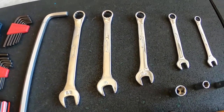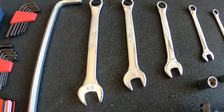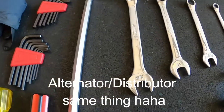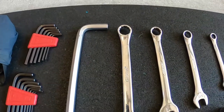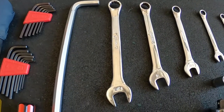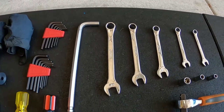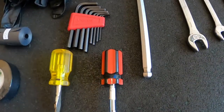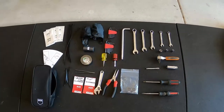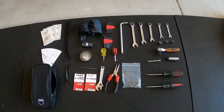If I want to take the carburetor off for whatever reason. 14 mil — I use that for quite a few different things, mainly the alternator if I want to adjust the timing. And the 5/8ths — that's going to be used for the carburetor needle and seat adjustment, if I want to adjust the level of the fuel in the fuel bowl. And the big allen key here is for the wake tower. So all this fits in that little bag.